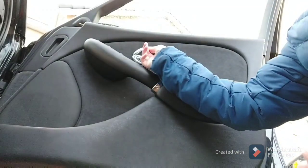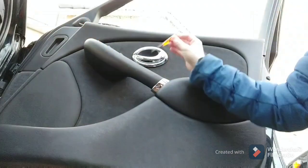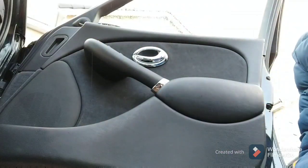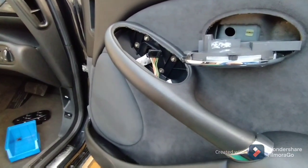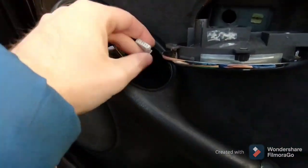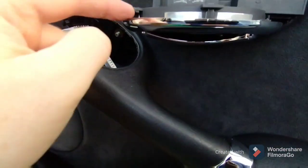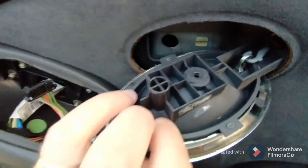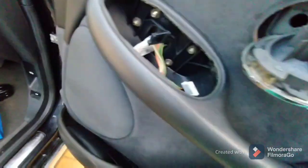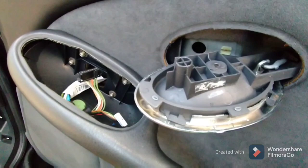The first thing you need to do is prise off this little cap in the centre here. There's also a screw in here and you need to prise out the switch pack as well, just to get to the fixing. The switch pack has two plugs — one at the front and one at the back. You need to be careful and pull it back and out, otherwise you break these clips. Turn it over and you can see there's a little hook for the door mechanism that needs to come out as well, and then there's your little screw. We'll go ahead and take out the door mechanism and then have a look at how to get the actual panel freed off.